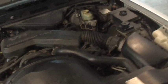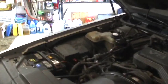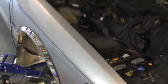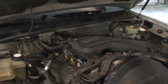Now I'm gonna guess that brake fluid came up a little bit. I can't remember where it was. Yeah, just a little bit. It was kind of here somewhere. Now do not press the brake pedal yet. We have to do the whole other side exactly like this, and then we're gonna go in and press the brake to the floor.